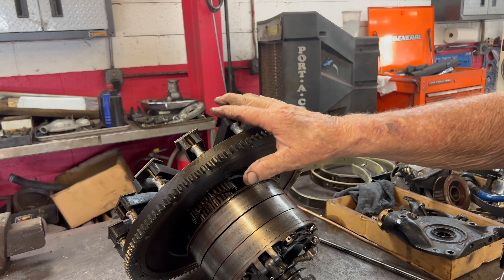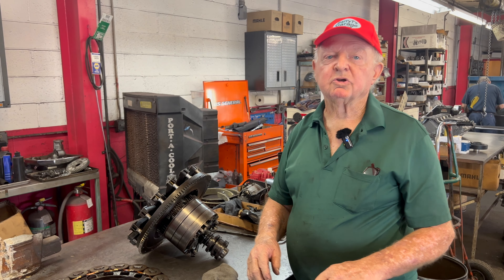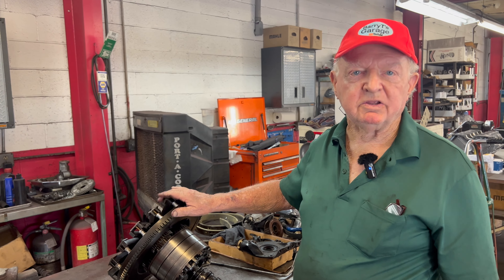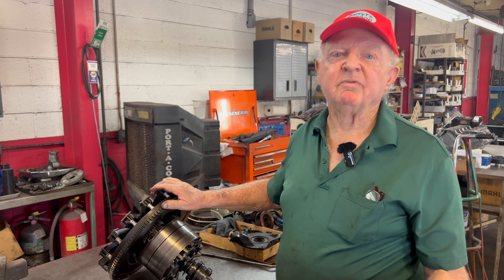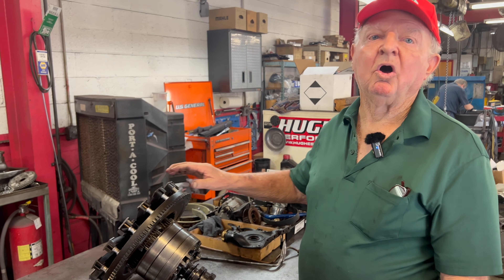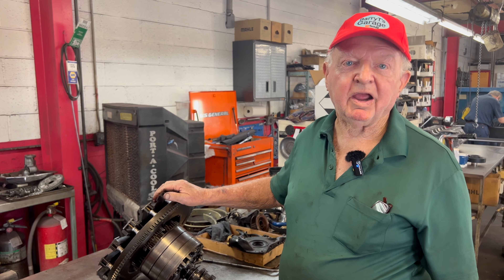Then the motor oil, the big tank for the oil pan - motor oil and transmission oil - is all the same. It's 30-weight motor oil. Because this runs in the oil, it throws oil everywhere inside the engine - that lubricates the pistons, the rods, the camshaft, everything in the whole motor. One big splash - looks like a dishwasher. And that includes the generator set - all in oil. Splashing oil everywhere. Of course it leaked out the cracks somewhere.